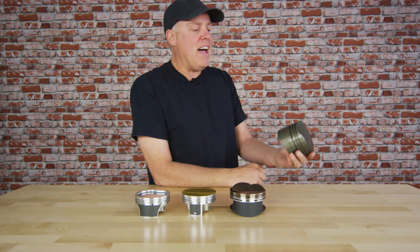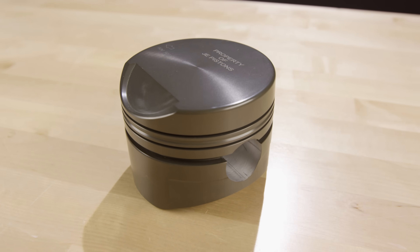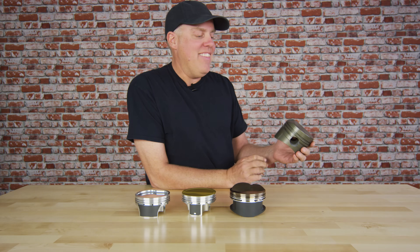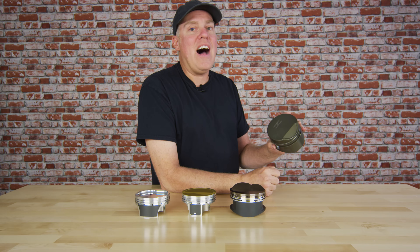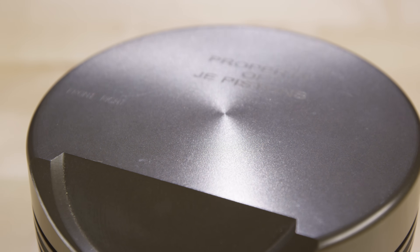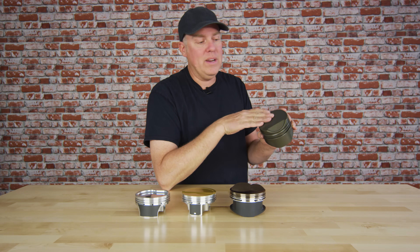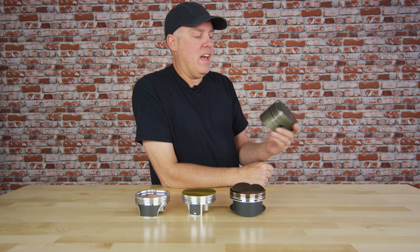And then last, we've got the Cool Coat, which is actually hard anodizing. Look at this — this is a Top Fuel Dragster piston, and that coating is basically designed to make the piston survive a very harsh fuel. While it's used on nitro and they probably throw these away after a run or two, this can be really important if you are a methanol guy and you want your piston to survive that really acidic methanol that can end up pitting the piston. You can order that hard anodizing called Cool Coat.